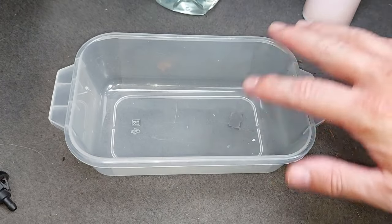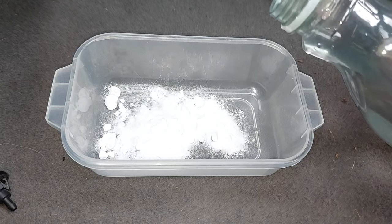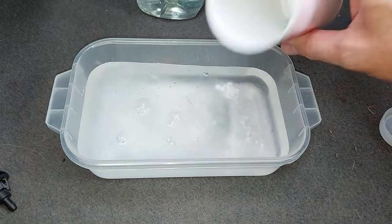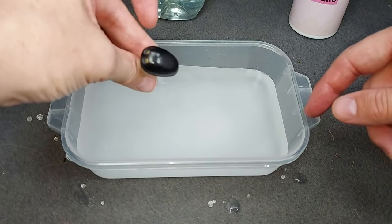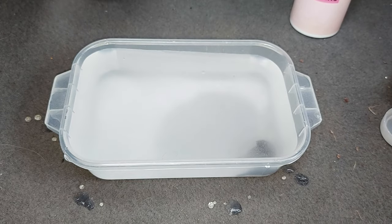Now it's time for a deep penetrating bath using our plastic pot and bicarbonate of soda — let's sprinkle some in there, and of course some water. It's not fizzing out spectacularly, but never mind — let's pop a bit more in, give it a stir, then drop in the windscreen washer jet and let it have a good soak. Just got to wait a little while now for the solution to work its magic, then give the washer jet another clean with the dental brush and rinse it off with fresh water.